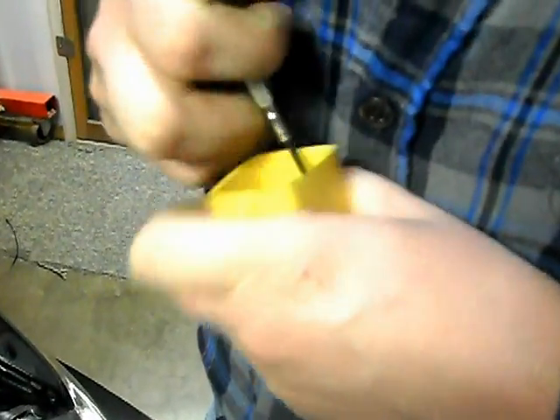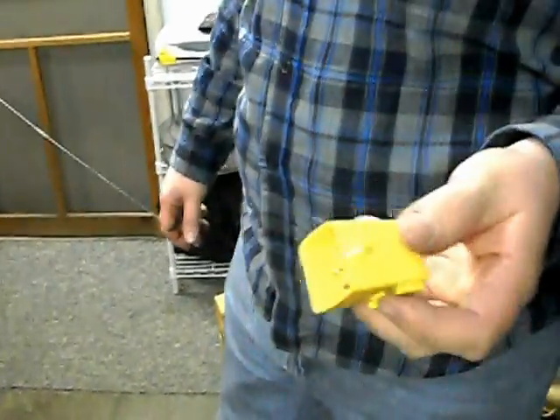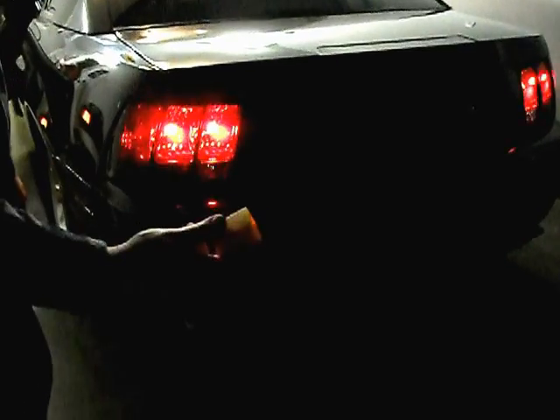There we go — she's all ready to go. I do have a stock flasher with the 3.3 uF capacitor still in it. I'll throw that in — this is just one I picked up from AutoZone, this is just the stock flasher. I'll open up the garage door so you can see stock versus the new flasher. Here — hazards on — this is the stock speed. When you do sequential tail lights they're pretty quick, and that's with the 3.3 uF capacitor.